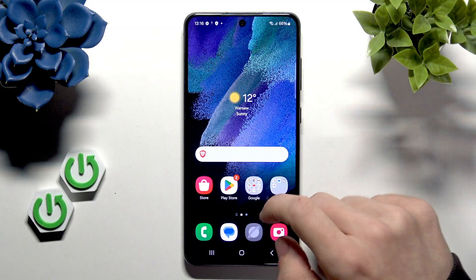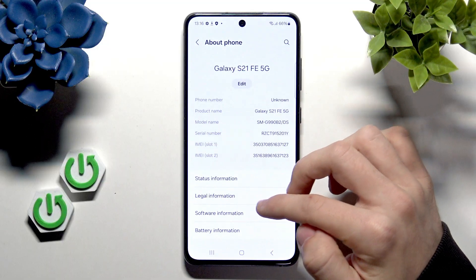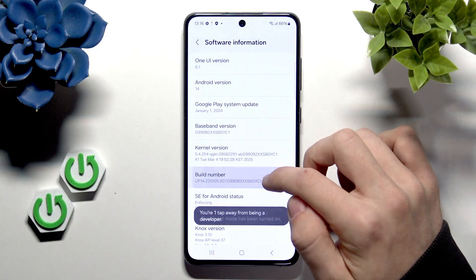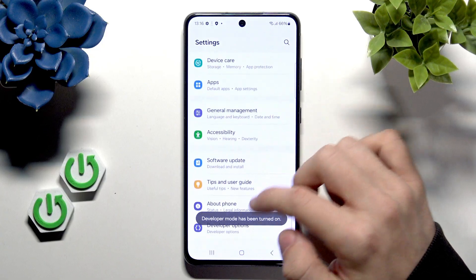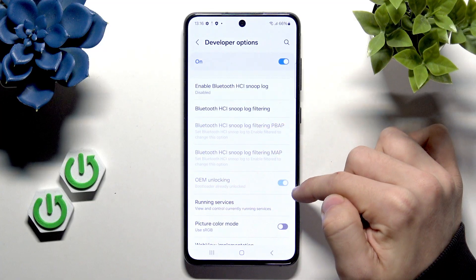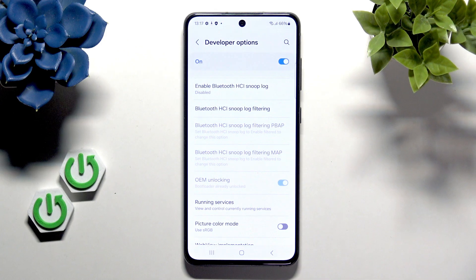I have set it up, connected to Wi-Fi. As you can see, we can go all the way down in settings to about phone, software information, click on build number seven times, go back, go to developer options, and now if OEM unlocking is enabled and grayed out, then it's all done. I hope that this video was helpful. Don't forget to like and subscribe and I'll see you in the next one.